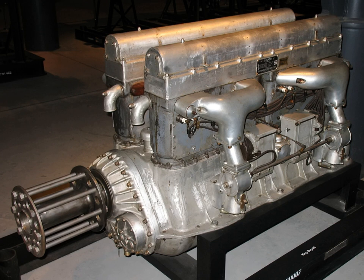In tandem twins, the motor has two crankshafts, one for each cylinder, which are joined and kept coordinated by load-carrying crank phasing gears connecting the two cylinders. The design has been used in motorcycling and go-kart racing. The tandem twin layout has virtually no benefit for a four-stroke engine, with the exception that primary imbalance can be completely cancelled by the counter-rotating crankshafts. The layout is used only with two-stroke engines, since these must have a discrete crankcase chamber per cylinder. The prime advantage of a tandem twin two-stroke is that the engine can be very narrow while allowing chain final drive without a power-wasting 90-degree turn. The layout also simplifies the use of intake disc valves.